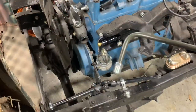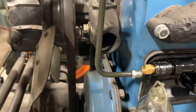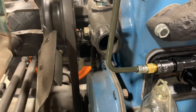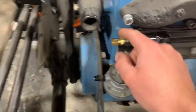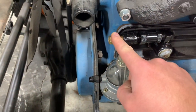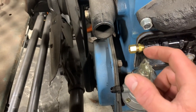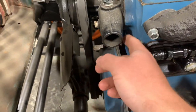Here's something I didn't think about — that's about as short as I can get that bend and still be able to flare it, and when I put it on down here it comes out right in front of the water pump, so that's not going to work. But I've got another plan. I swapped out that inverted flare fitting for a compression fitting — now it's quarter inch MPT to a five-sixteenths compression fitting. What that means is I can do that bend, then cut it off as short as I can get it where I still have enough to stick up in there, and hopefully it'll clear this water pump.